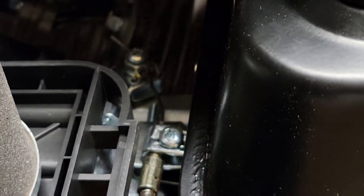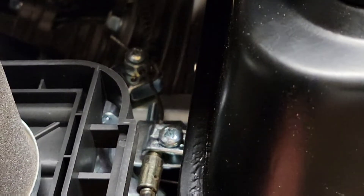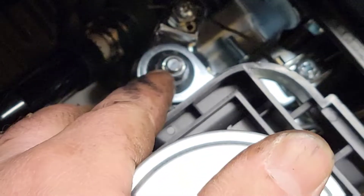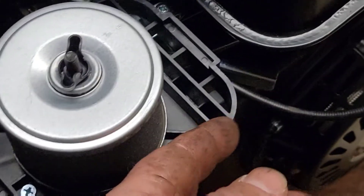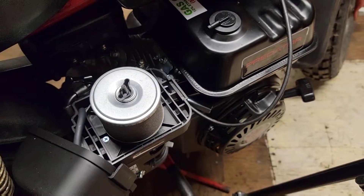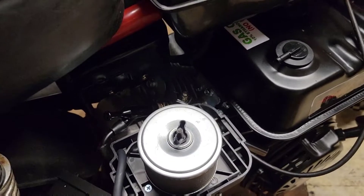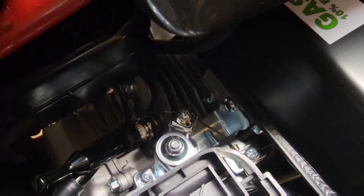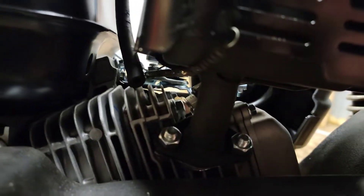So I got my throttle cable in here and tightened up right there, and got it mounted in the hole back there, which works the throttle cable. You loosen that bolt up and it loosens the lever so it'll move freely instead of being so stiff. When I did that I also needed to add a throttle return spring, which is down here — connected it right there, ran it around, and just attached it to the muffler right here. That'll work for now for testing.